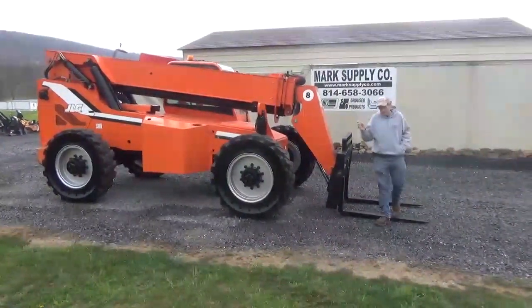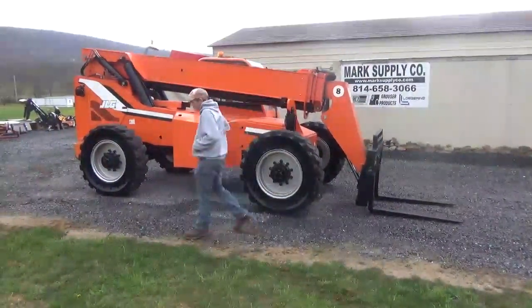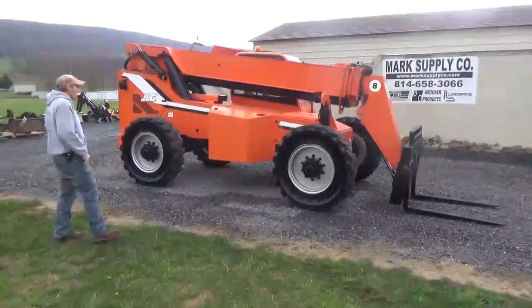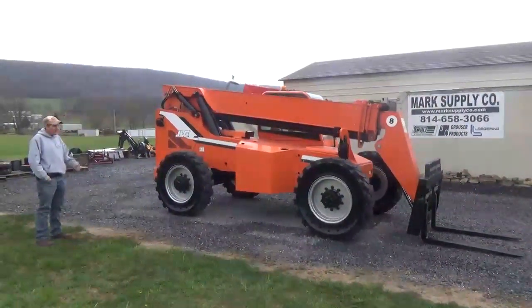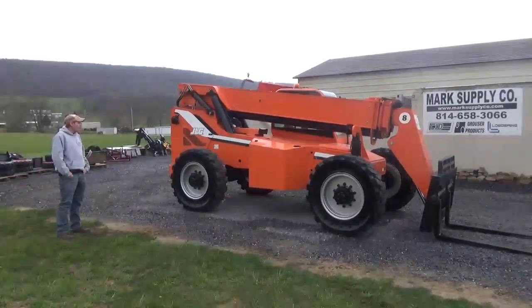2012. This does not have emissions on it. 2012 would be just the start of the 3.3s having a cooler up on them, but there is no DPF, no urea. Still blows black smoke just like mine do. I have the same engine in both of mine.